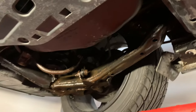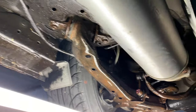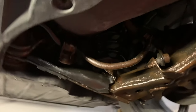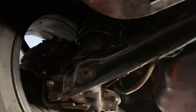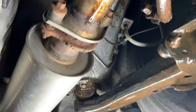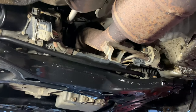I've also scrubbed the rust on all the control arms, sway bar end links, and the sway bar itself, and applied fluid film on them. There's no point scrubbing out every last bit of rust — we just wanted to protect it so it doesn't rust further, including the springs. The end links and some of the other parts underneath, like the wheel wells, are all coated with fluid film now. The pinch weld here again, and the front as well. Once this dries, I'll leave it for a day and then add more fluid film to protect the whole subframe.